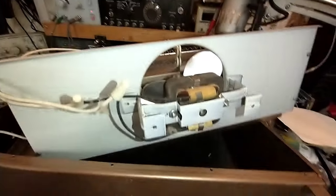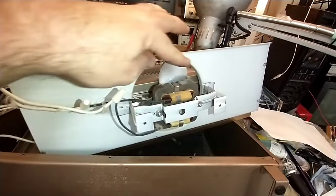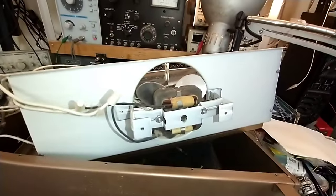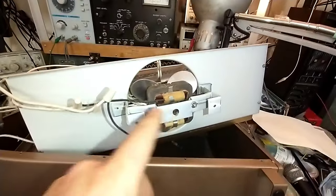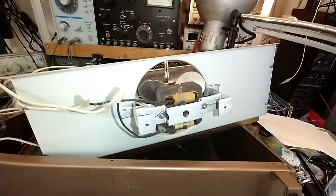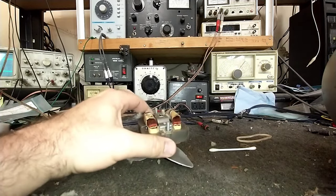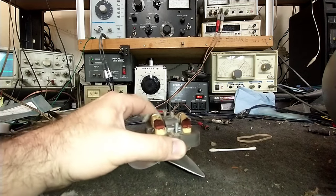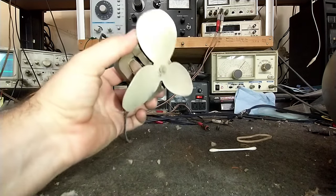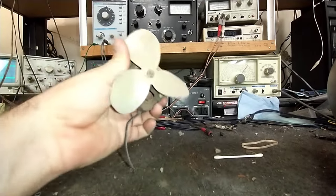The best way to do this is to just take it out from the bottom. This motor is very sticky — really hard to turn — so we definitely want to make sure it's operable. I'm going to remove the wire nuts, take the motor out, then open it up and take a look. You take loose the two nuts and turn the motor 90 degrees so that you can clear it and get it out. Nice little shaded pole fan motor.